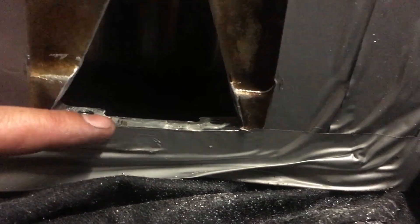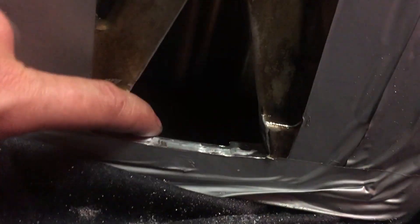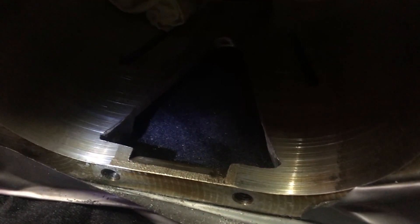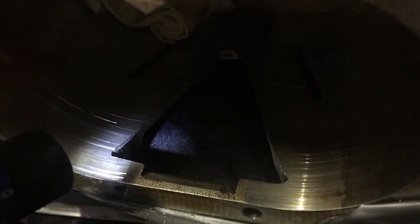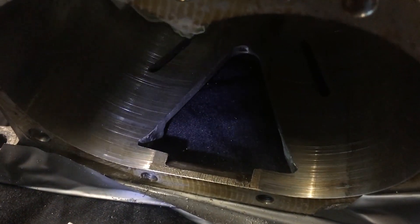Okay, finished with the porting. We've knocked those out and filed it right down - you can see that's pretty damn flat there now. No burrs on here, it's all nice and radiused. One thing to point out: inside here where you can see the Christmas tree shape, those little bits in the corner are where we've cut out. Don't forget to run a razor blade over those edges where you've cut out the aluminium knobs, because there will be burrs after you've filed and jigsawed. Just run a normal razor blade along all those edges to make sure they're 100% burr free - otherwise you're going to end up tearing up your rotors.